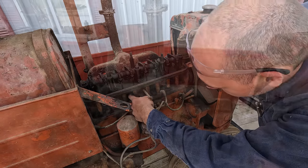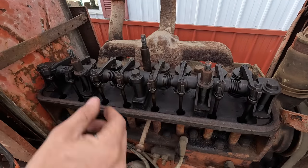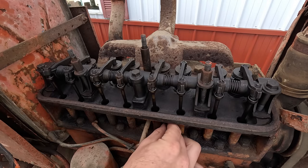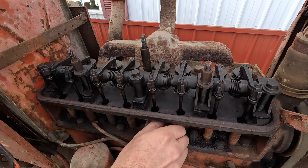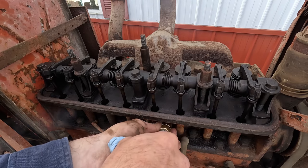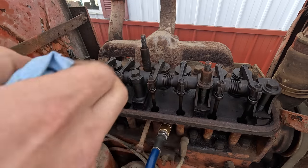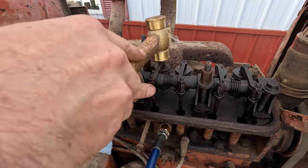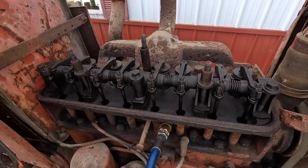We were going somewhere. Both cylinder 2 and 3 are at the top of the stroke without any valves open. So I'm going to introduce some air pressure into them. Just going to hook shop air up, and that'll help push it backwards, I believe. Helps a little bit.